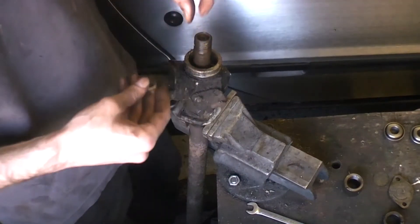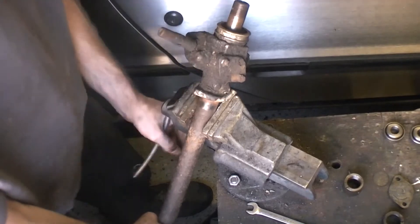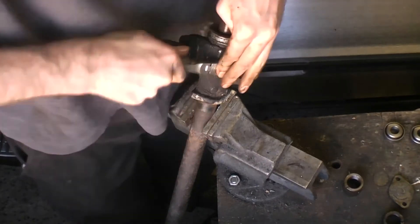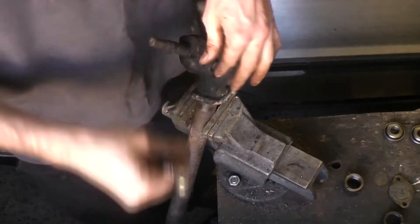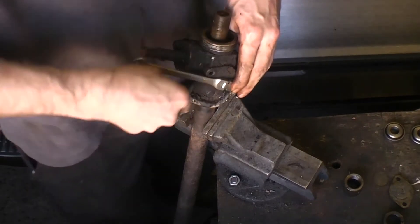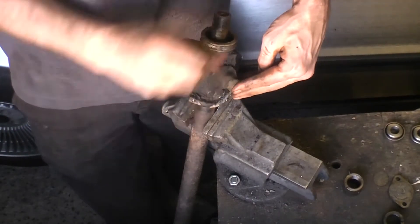Out comes the little shoe and little spring — when I took it out earlier it was so grotty the spring pinged off somewhere in the garage and took me ages to find. Now I want to take apart the pinion housing. Two terminal bolts on both sides — I wasn't sure what state they'd be in to undo, as this car definitely stood in water for some time. What came out of the steering rack when I pulled the boots off was distinctly muddy coloured. This rack was rejected by the company I usually use to remanufacture racks, so I'm pulling it apart myself to see if it's really destroyed.